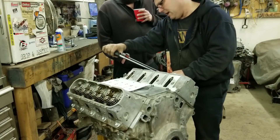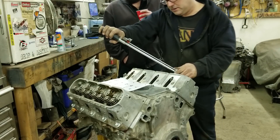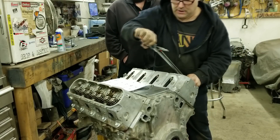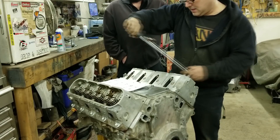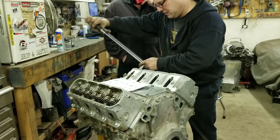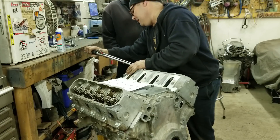I don't know why they have to have that angle finder - why can't they just say 40, 60? That angle finder thing would take me half an hour. For the rod bolts I basically tightened them, checked them to see what pounds they were at, and then just tightened to that next time.